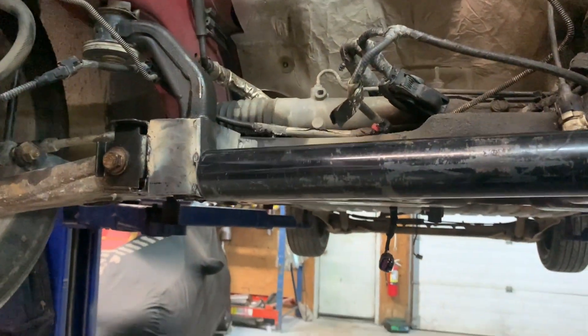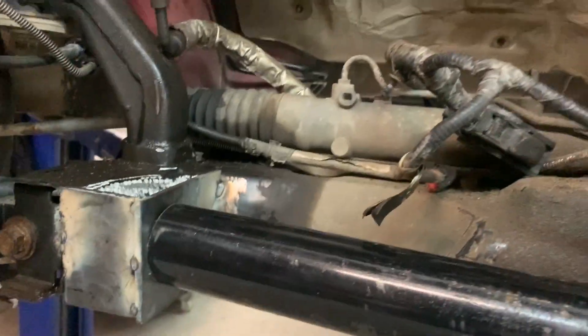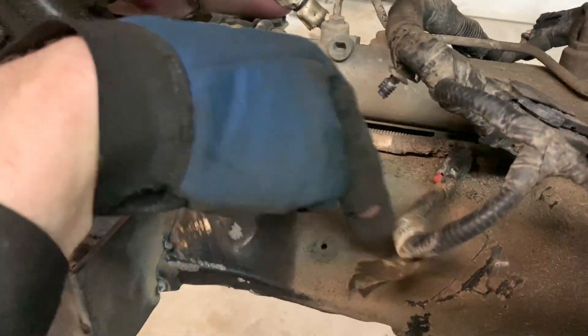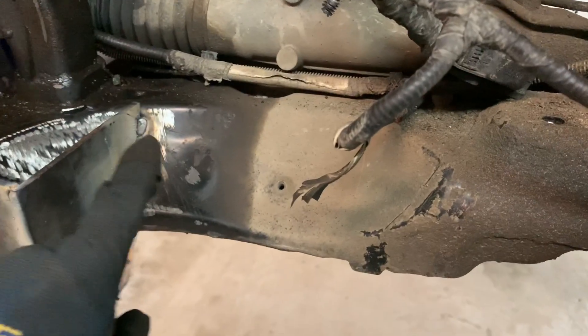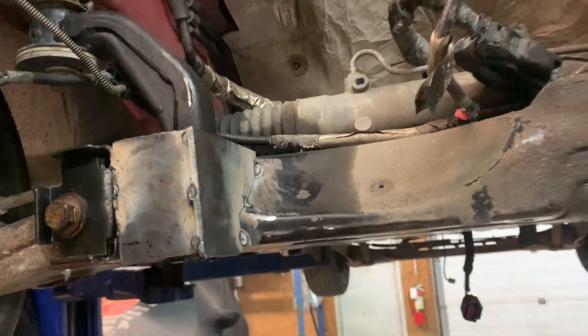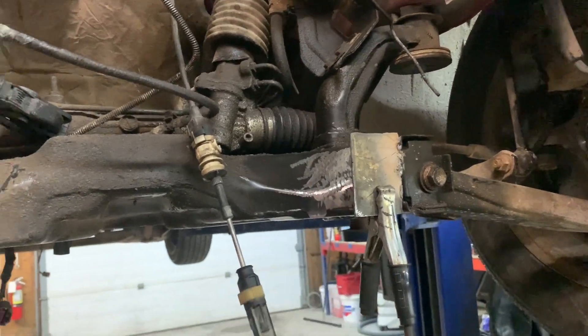It actually looks kind of cool. So now we can really see what we've got going on — this is going to be our crossmember, and that is going to go right up against like that. As for my rack, I am going to mount the rack up here, so I'll run tabs off the pipe somewhere when I get the rack adjusted, because I might have to lean the rack a little bit one way or the other. I've got some quarter-inch plate that I can angle whichever way I like, and then drill it, put bolts in, nuts, all that stuff, and we'll be good. I'm alternating between sides, so I've got this plate tacked in now — I'll go over and get the template cut out and do this one.